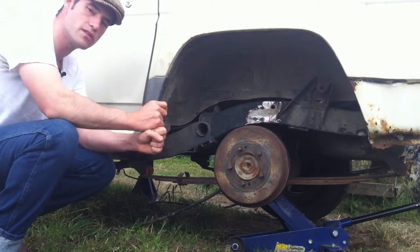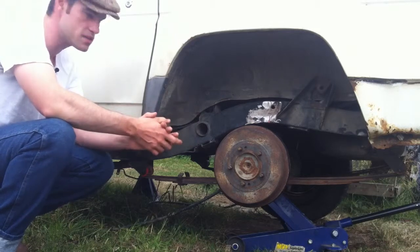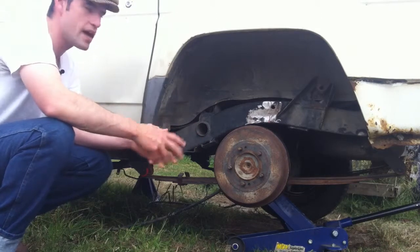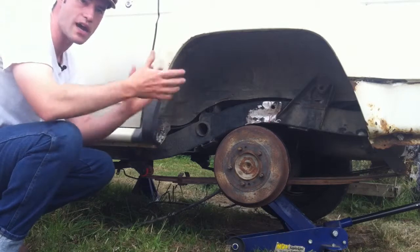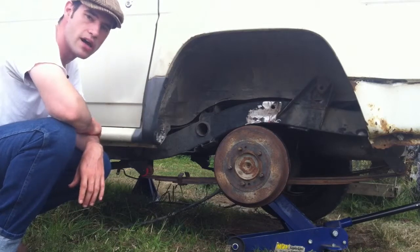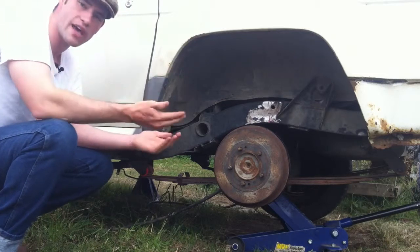If you can keep springs where they were originally placed with whatever suspension your vehicle came with, that's probably the best option. Directly under the chassis rails is the most typical but not the only option. For me that worked out fine. If I needed to reduce height, I could have mounted side-mount chassis brackets to drop the chassis closer to the axle. As it is, with a little modification of the leaf packs and making sure my shackles were the right length, I have the height I want going under the axle instead of over the axle.